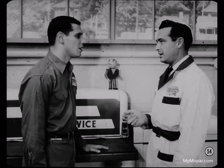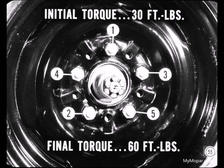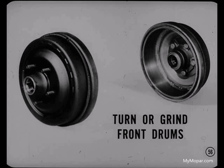When you talk about tenths of thousandths, you're into specifications we can't measure with an ordinary drum gauge or dial indicator. Even if we had special-purpose gauges, the best they could do is tell which drum is out of specs — we'd still have to machine a pair of drums to correct the chatter. Sometimes drums are distorted because the wrong wheels were installed or the stud nuts weren't tightened correctly, so make sure the wheels are right. Next, loosen all stud nuts and re-tighten them to the proper torque and in the proper sequence. If this doesn't stop the chatter, turn or grind the front drums to correct the irregularities.